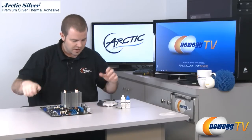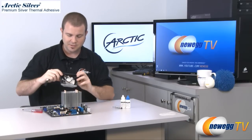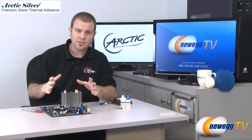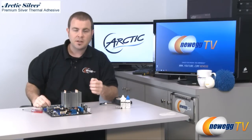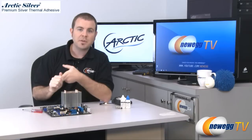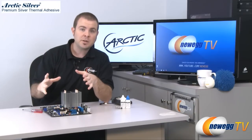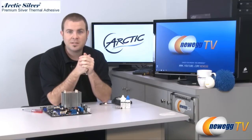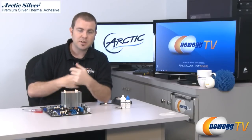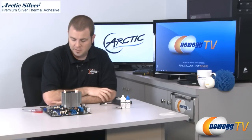That should be just about good. Now of course we can't forget that once this is mounted we want to snap our fan back onto the heatsink and plug that in. Once you have it installed you should boot up your computer. If you have a benchmarking application or a CPU burn-in utility, Linx or Prime95 are great ones to use — they just max out your CPU temperature. You can keep an eye on your temperatures and see how well your new aftermarket heatsink fan is performing, and that will also help the thermal paste set in and give a few degrees better performance over time compared to right after you first boot up.